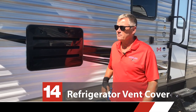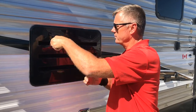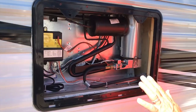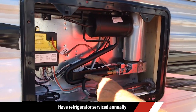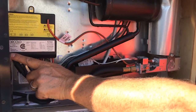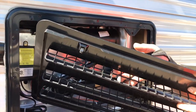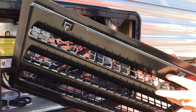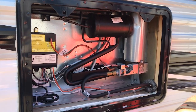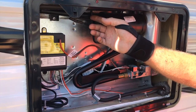This is the outside vent cover of your fridge. I'm just going to open it up by twisting these vertically, and then this just pops out — and there's the back of your fridge. The back of your fridge is really tech territory. This is your gas control and up here is your 110 element — it plugs in right over here. The real reason I'm showing you how to take this cover off is to show about these holes. These holes allow wasps and other critters to come in and make little nests inside here, but you can't block these off. It's important for airflow that there's no restriction here so that the air flows freely across these cooling vent tubes.